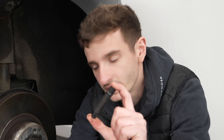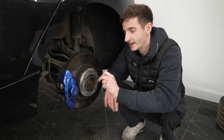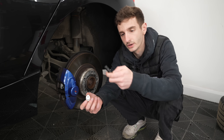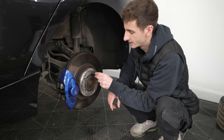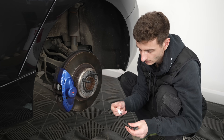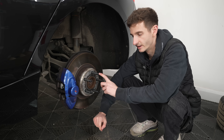I'm going to do all the easy things whilst Kai does the hard stuff. A stud conversion kit essentially just replaces the standard wheel bolts with a stud - makes it easier to get the wheel on and off, and once fitted they also look a little bit nicer. They're super easy to install. Grab your stud, grab a little bit of Loctite, dab a tiny bit on the stud, then get it screwed in. I'm going to tighten them up torqued to 30 Newton meters using a 5mm allen key.